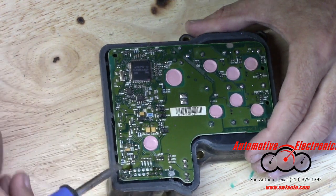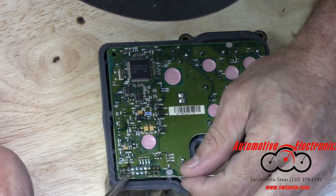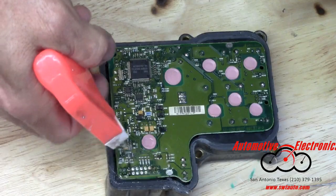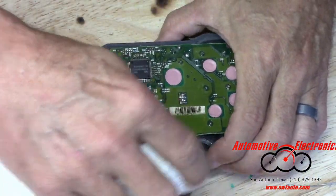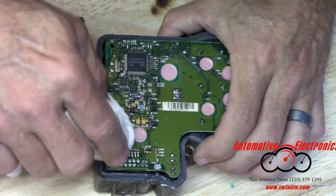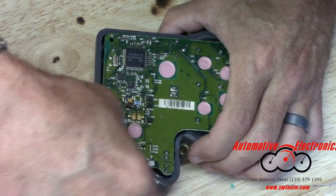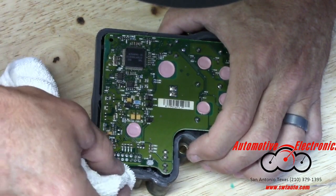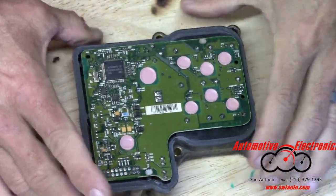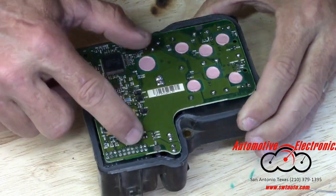Clean this stuff with a bit of alcohol. 99% alcohol does not hurt electronics, unless you're talking about a stepper motor where it can get down inside. Don't submerge it. We're just trying to clean up flux here. You can see those came out a whole lot prettier with the flux applied.